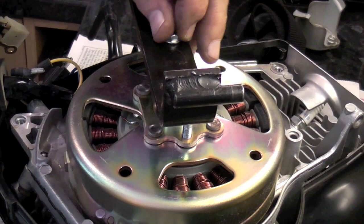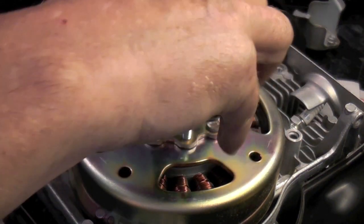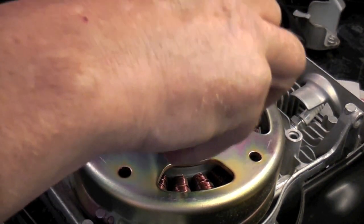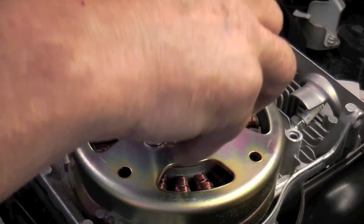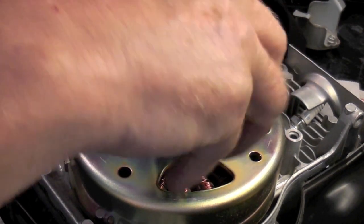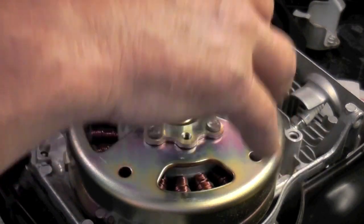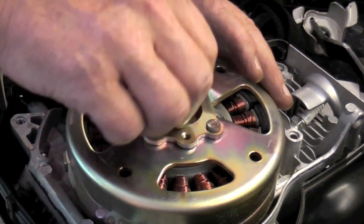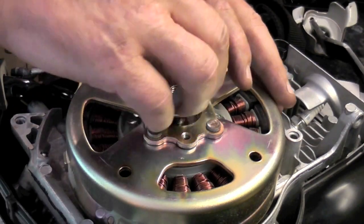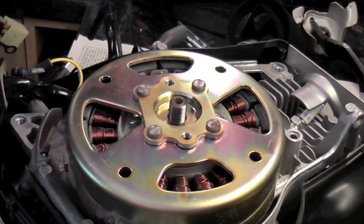That's off — you'd hear a crack. Now you might think you're ready to take the flywheel off, but you'd be wrong, because the magnetism makes it extremely difficult. The best way is to take off the flywheel and stator as a complete lump.